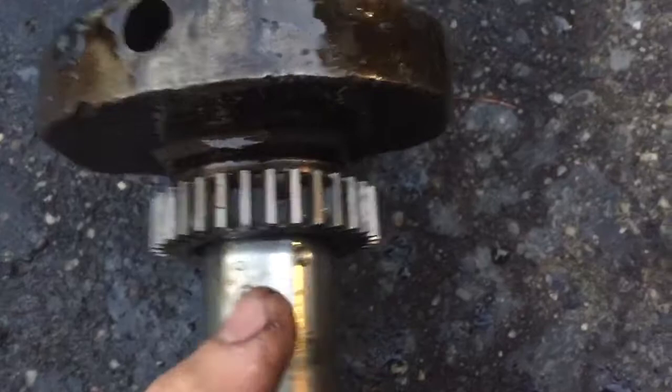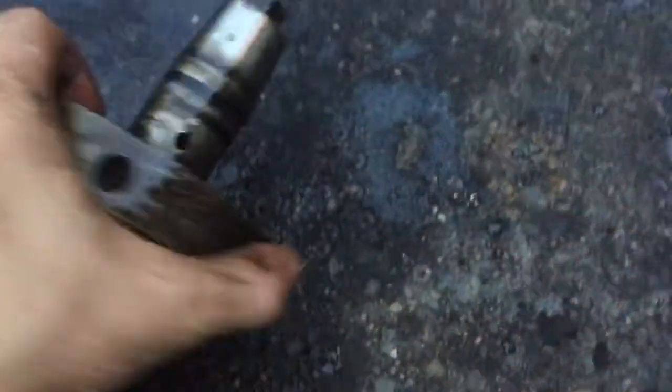So the way it works is it pulls oil in through a sump at the bottom of it into the crankshaft here, and the pump forces the oil through this little hole right here, and then it goes through. This is hollow. And then comes out of these two to lubricate the pistons on the connecting rods. And then the leftover oil comes out of the upper piece here of the upper shaft.